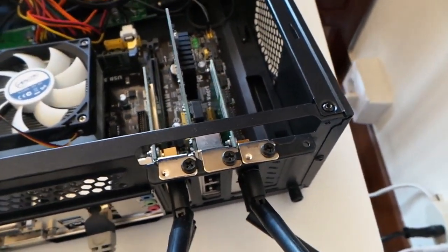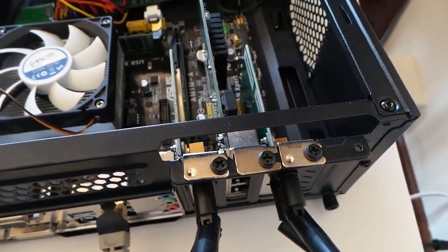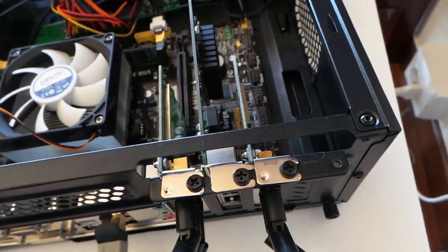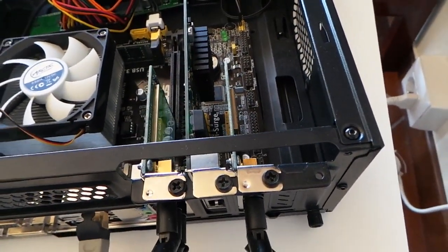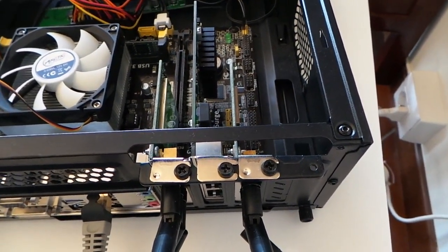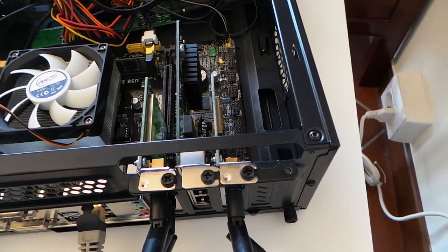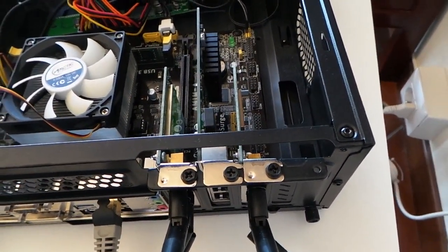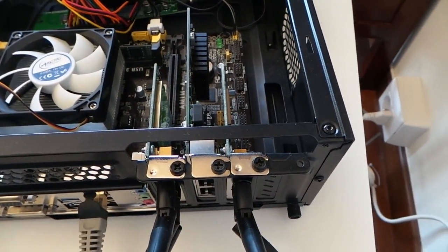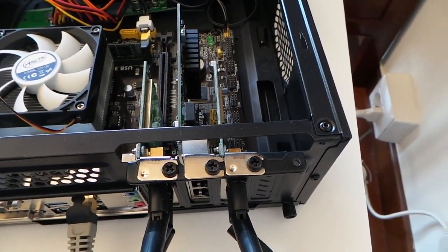Now when choosing a Wi-Fi card especially, you should be careful, because if you're using Linux, as I am, you should choose an Atheros Qualcomm chipset, because they're really a lot more reliable. Linux likes them a lot more, the drivers are better, and so on. So these two wireless cards use the ATH9K driver on Ubuntu 16.04, which works flawlessly out of the box. And I suggest, if you don't want to geek on your computer for quite a lot of time, to choose an Atheros Wi-Fi card, because it's the best and the easiest experience that you can actually have.